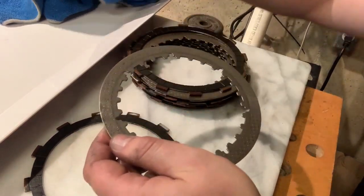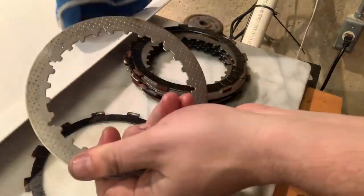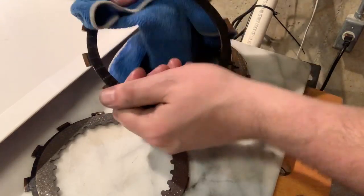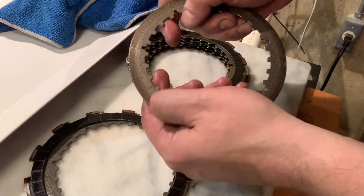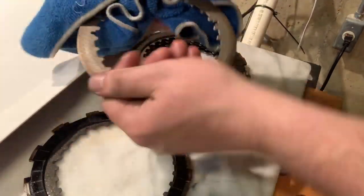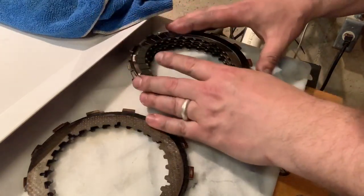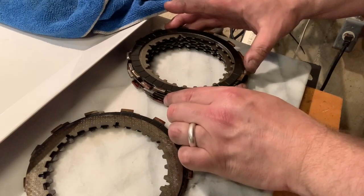I'm feeling good about my clutch plates and friction rings. Now I'm going to go through each of the steels and just make sure that I get any residue off of these. These all look really, pretty damn good. Just giving each one of these rings a nice wipe, cleaning off any dirt and debris. This one, you can see it's not burned — it's just kind of tarnished a little bit. Compared to all the photos that I've seen, these are totally operational and still in good shape. I'm going to work my way through all of these and go back to time-lapse mode because this isn't exactly making for thrilling video content.